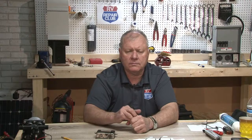Okay, Frank from earlier said, sorry for the confusion on the 2004 Monaco. There is an electrical panel inside the door on the outside of the RV to the fridge pilot light area. The manual states that in the event the gas fails to light, a little jumper wire is required to touch two named points on the electrical panel to renew the connection. I hired a gas guy to do this, and when he did, a fuse blew in another panel. That fuse was replaced, and the fridge then fired off on gas and worked all summer.